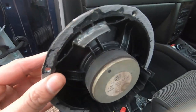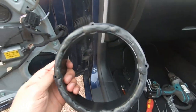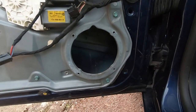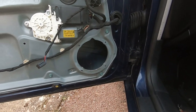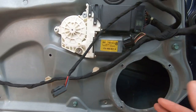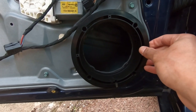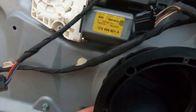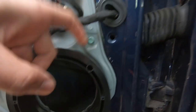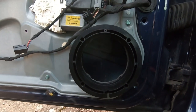Because this old speaker had a foam back on it - kind of like a seal against the door - I had some of these draught-strip foam left over from when I sealed around my door, and I'm just going to see if it works. Otherwise I'll have to use some foam backing to replicate what we had on the old speaker, just so as not to let water through and to keep everything nicely sealed. This has gone on very nicely - I used the clips at the back, put the screws through the holes, and my seal is around the edge and inside. I can trim any excess off.